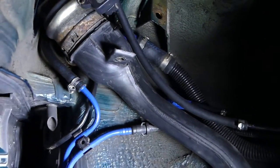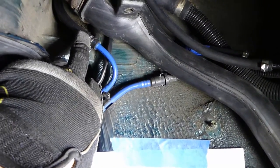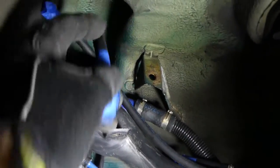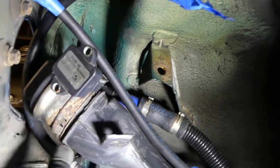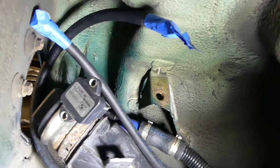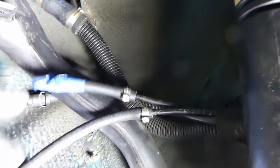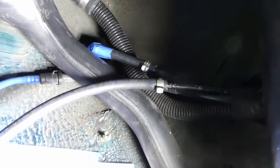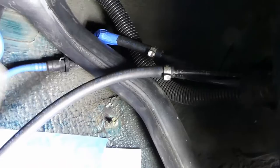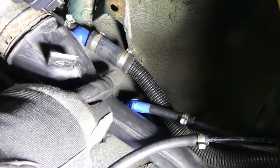Underneath, you can see this is the 8x13 line that goes to the top, reaching over and around the back of the filler neck. That's an 8x13 fuel hose. Then there are these two fuel hoses — one with a very short piece and one a little bit longer — both 6x11 millimeter fuel hoses. These are brand new; I'm replacing all of the hose back here.